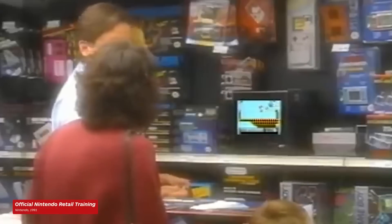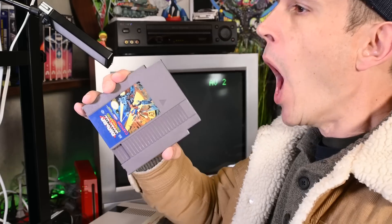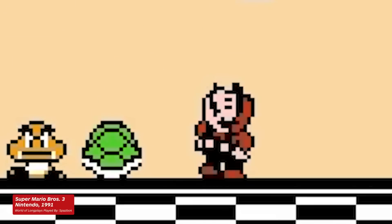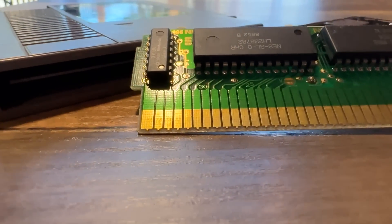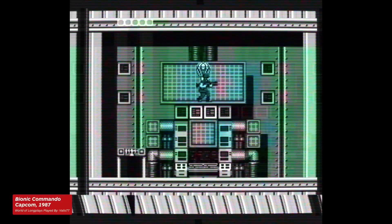In the 1980s, everyone who owned a Nintendo Entertainment System knew the only way to fix a faulty game was to eject it, hold it to your lips, and blow on it. If it didn't work after that, you simply repeated the process with more force until it finally worked. This was not only wrong but super gross, because you basically just sprayed spit particles all over your copy of Super Mario Bros. 3. On top of being unhygienic, your kid's spit probably also contributed to corrosion on your cart's contacts. If your mouth was particularly juicy, a glob of nasty saliva could actually short some of the contacts, and that's bad.